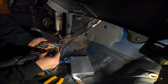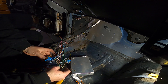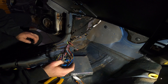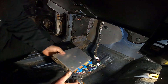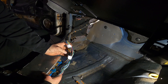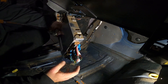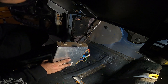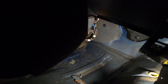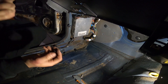Now that is manualized. I like to tape up the ends of these individually and tape it all back into the loom nice. I'm going to get that done. Alright — and there we have it. It's all back together. I ran out of black tape so I had to use white, but the crimps are all taped in, the diode is all taped in so it can't be damaged. The ECU can then go back in its place — slot that in. The wiring is all tucked away like factory and you'd never know.